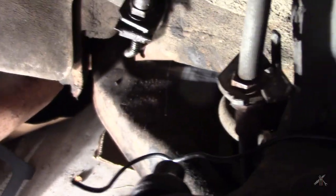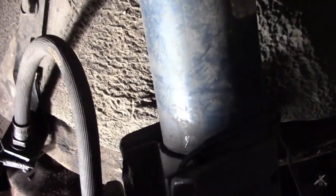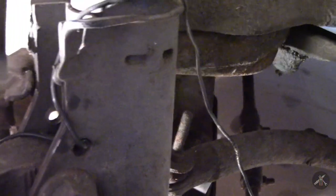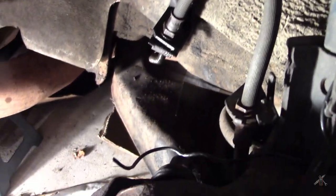I'll rinse it down with some alcohol and make sure it's clean. Then I'm going to come in and lift the caliper back off — the bolts are in place but not tightened. I can take out the banjo bolt on the back here; you can't see it but it's down toward the bottom. I did have a bucket of water here along with two fire extinguishers.